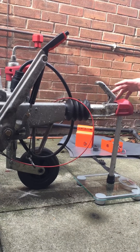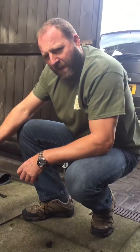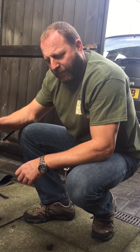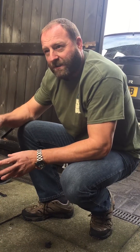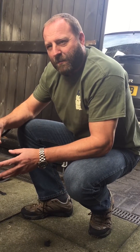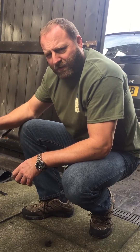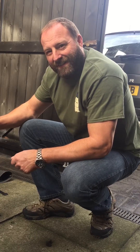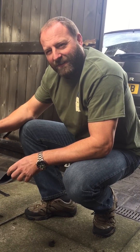There are legal limits - the minimum must be twenty-five kilograms, and ideally you're looking for a weight of between five and seven percent of the actual weight of your caravan. If we take six hundred and thirty kilograms as the weight of our pod, forty-seven point one kilograms puts us just over seven percent, which for us is fine. This will allow you to have a safe, stable, and legal setup.